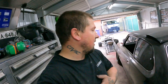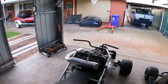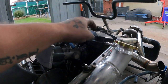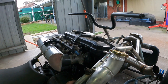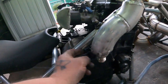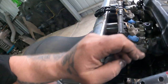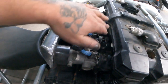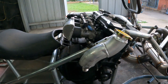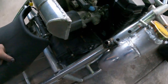It was a busy day and we got a lot done. First off we made up the coolant reservoir — this has to be the highest point of the engine. It's dash-12 from the radiator, and on the other side there'll be two lines going in: a 90-degree fitting going one way and one coming from the other direction. It's a weld-on piece taken off the radiator, coned on the bottom to adapt to the dash-12.